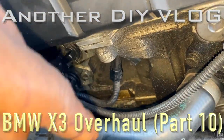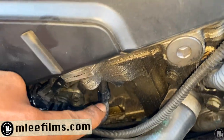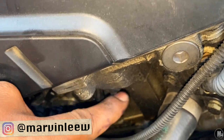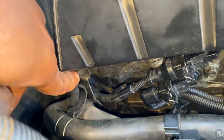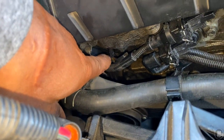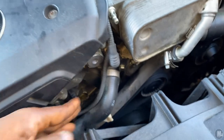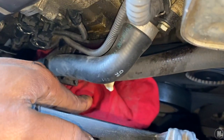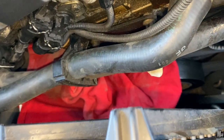All right, so the next spot I got to get to — cleaning these two things off. Next thing is to take this out, which is the camshaft position sensor, intake one I think. I'll unscrew that, pull it out, disconnect it, put the other one in. The other one is right here. I started tired this morning, so one thing I did was put a towel down at the bottom so in case I drop a screw it lands right there — not that many people think about that.